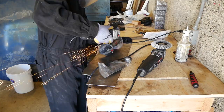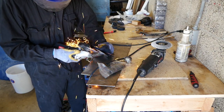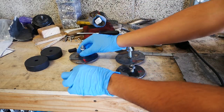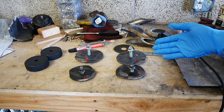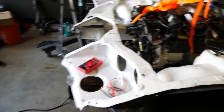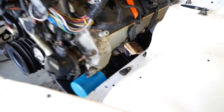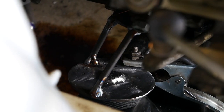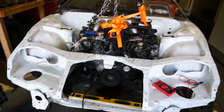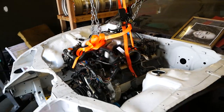Bye-bye old motor mounts. I got the right side and left side mounts back down to just base plates. I'm going to put these back on the car with the engine and refab them up for the new position of the VH. Just finished welding them up — you can see the side that goes to the crossmember and the side that goes to the engine, with about 3/8-inch rod in between. Same on the right side as well, and then I'll just unbolt the mounts to take them out and weld in a piece of DOM.